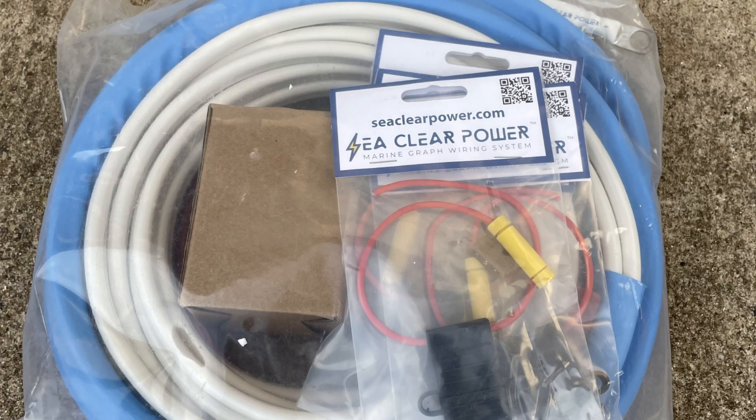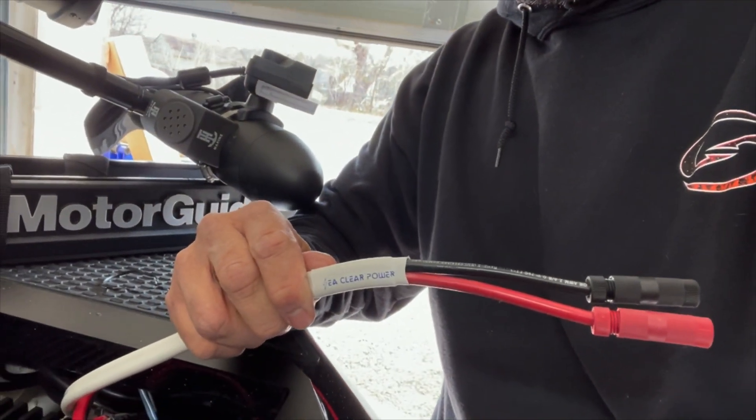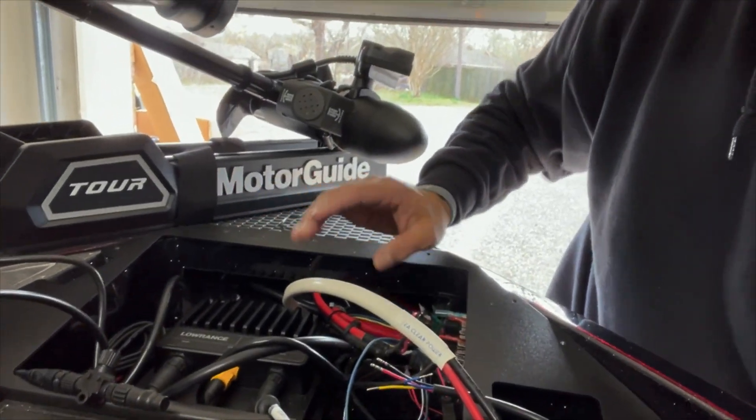But the main thing is you want to have direct power from your very back power source, your battery in the back compartment, all the way to the front. The guys up at White River Marine Ranger boats ran the Sea Clear — which is this guy right here — all the way, attached to my main battery power source in the very back of the boat. They ran it up along the side of my Ranger and made it super convenient where it just pops out right here underneath the bow panel. And that's going to give me uninterrupted power.